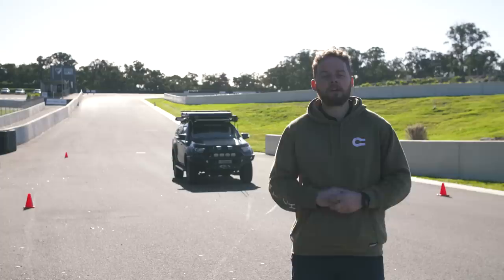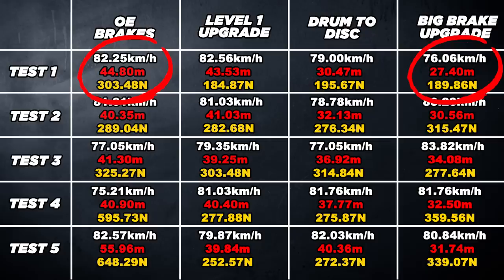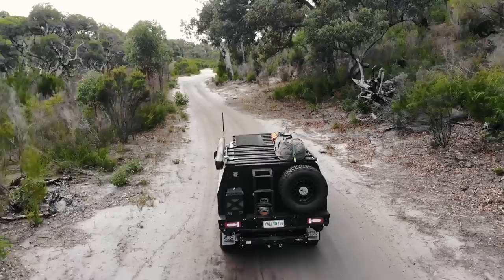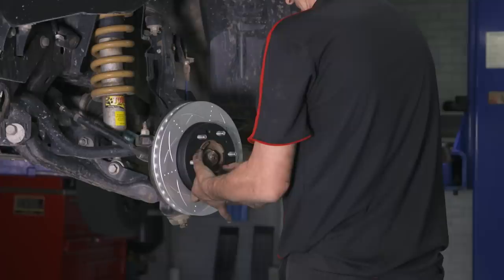Now let's collate all the data so you can see what kit is right for you. Each upgrade made an improvement over the last. The Level 1 upgrade performed significantly better than the OE brakes with minimal signs of brake fade. The drum-to-disc conversion provided a massive increase in initial braking performance but did show signs of brake fade after repeat efforts. The big brake upgrade had the biggest effect — a whopping 17 meters shorter than OE on its first run — settling into a consistent pedal effort and braking distance for repeat attempts. For a lightweight ute carrying tools during the week and camping gear or towing a tinny on weekends, upgrading rotors, pads, and brake lines will really come into its own.